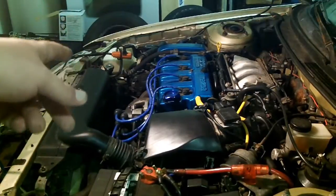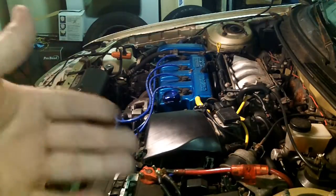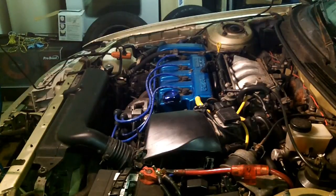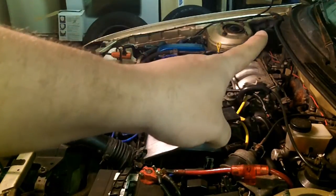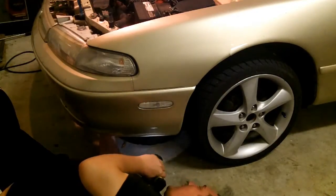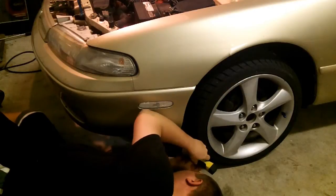In my case, because I have a coolant problem, I'm going to be draining and filling many times over the course of the next month or so — I'll just throw this in as one of those drain and fills. In your case, you do not have to drain the coolant. You can just disconnect the IAC and leave it pointed upwards so it doesn't drain any coolant out. If you want to try and do this without jacking up the vehicle, it's a really tight fit and you could get some on the ground. I'm going to try and cheat a little bit and not raise the car.